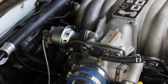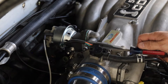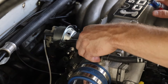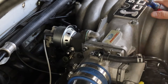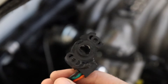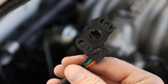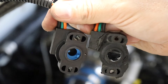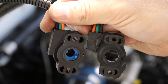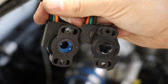I'm just going to use a flat head screwdriver to pull the old unit. There was RTV everywhere. Here's the sensor we got off — you can see that wonderful RTV all smeared in there. I'm going to go ahead and clean the surface of the throttle body now; I don't want to put my new sensor on top of that RTV mess. Here are the two sensors next to each other — the old one on the right with the RTV stuck in it, new one on the left. They're both the same Ford part number, but it looks like the blue plastic is the updated part. We're going to install that, and we're not going to use any RTV.